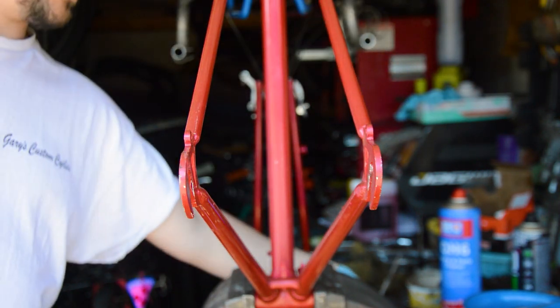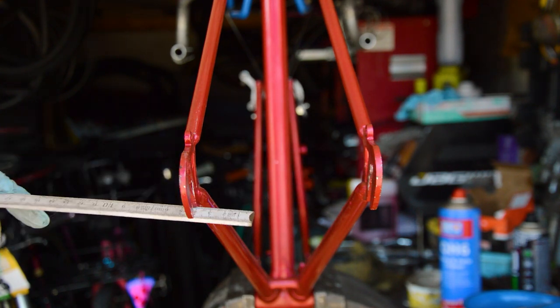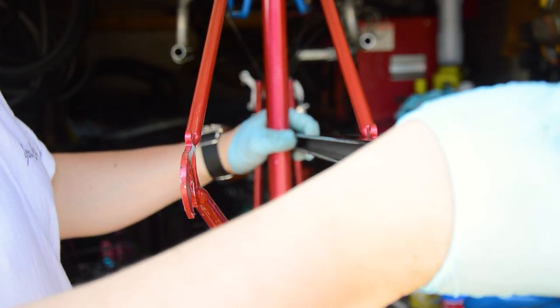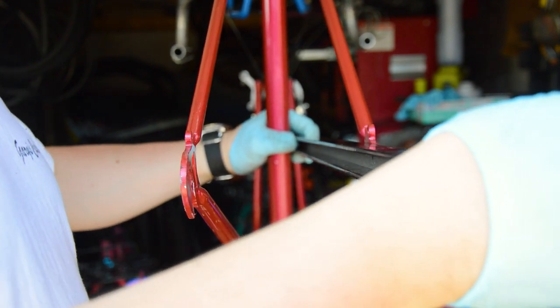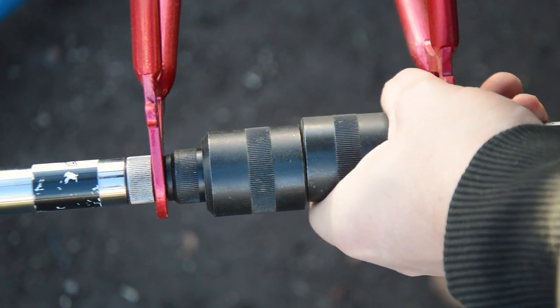Because my frame was bent, I did all the work using my frame alignment gauge as leverage to manipulate the rear triangle. If your frame is straight, a bit of threaded rod and some nuts and spanners is usually all that's needed to cold set a frame. After the frame width was set, I aligned the dropouts too, so here's an old clip for that for reference.